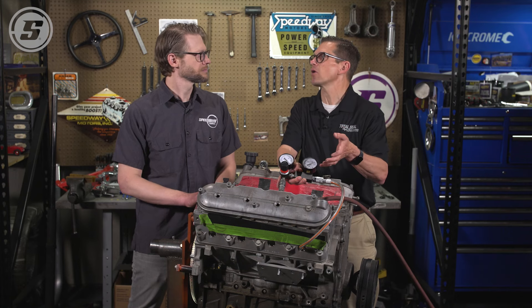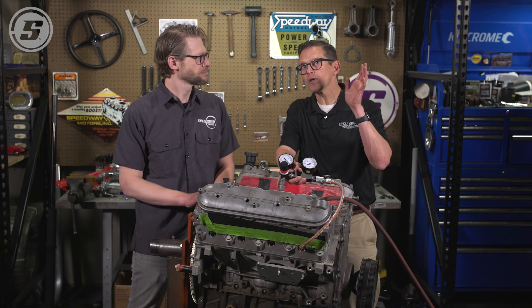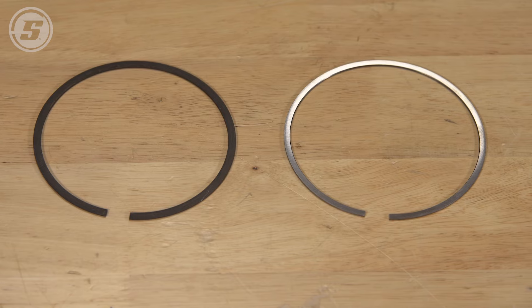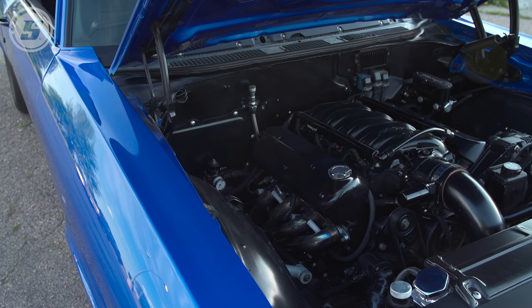The gauges say — we've got to turn this one back up to 100. Now we're at 100 psi going into the cylinder, but my differential pressure says I'm only about 70%. So this brings up an interesting question: at 70%, that's 30% leakage. Is that just worn piston rings, or has this engine been sitting so long that all the oil has drained off the cylinder wall?